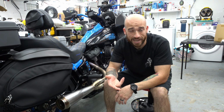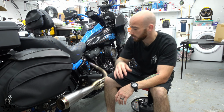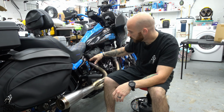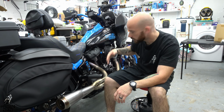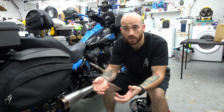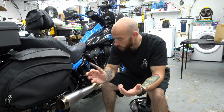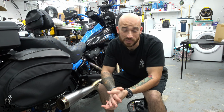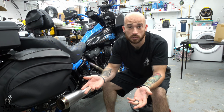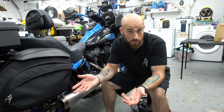Something that you saw me do was put anti-seize on all of the bolts. I definitely would not do any Loctite on any of the exhaust setups. For those of you who are familiar with it, exhaust bolts, either internal or at the flange nuts or the springs or anything, that was hot. Anywhere that exhaust bolts or metal contacts itself within the exhaust system has a tendency to want to sort of heat weld itself together. So we don't put Loctite on there because then it will really weld itself together. So we put a little bit of anti-seize, and then that shouldn't have any issues. I've always used anti-seize on all of the bolts for exhaust hardware, and I've never had any issues try to back themselves out or anything like that. So shouldn't have any issues here either.